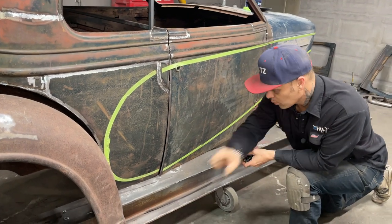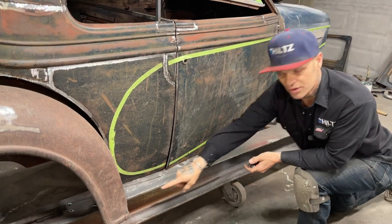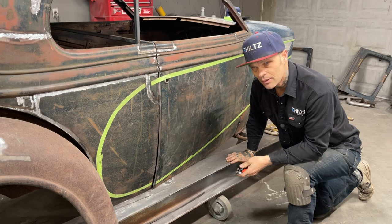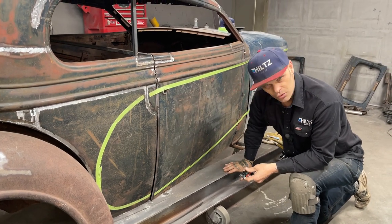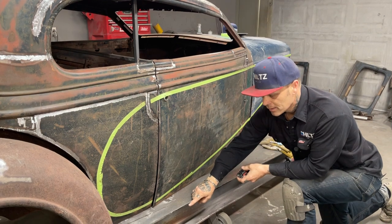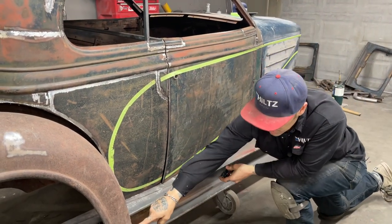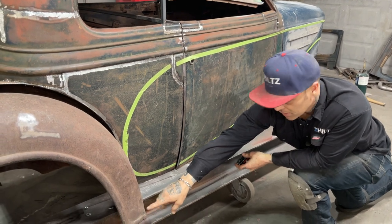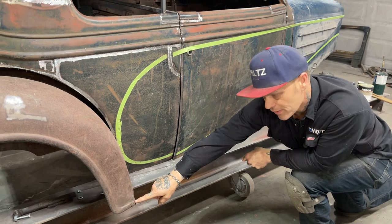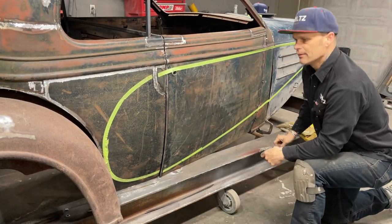And what am I going to say now? We'll make the outside lip on the bead roller, or we'll weld something to the piece of metal that comes out. I might use a trailer fender, actually. Have they got a nice roll on it like that? I'm not sure. We'll see what happens, and I might even use a small piece of square tubing because it's quite a long fender going up there. I might use a small piece of square tubing to weld to that fender all the way up along there to get that body line to make it rigid.